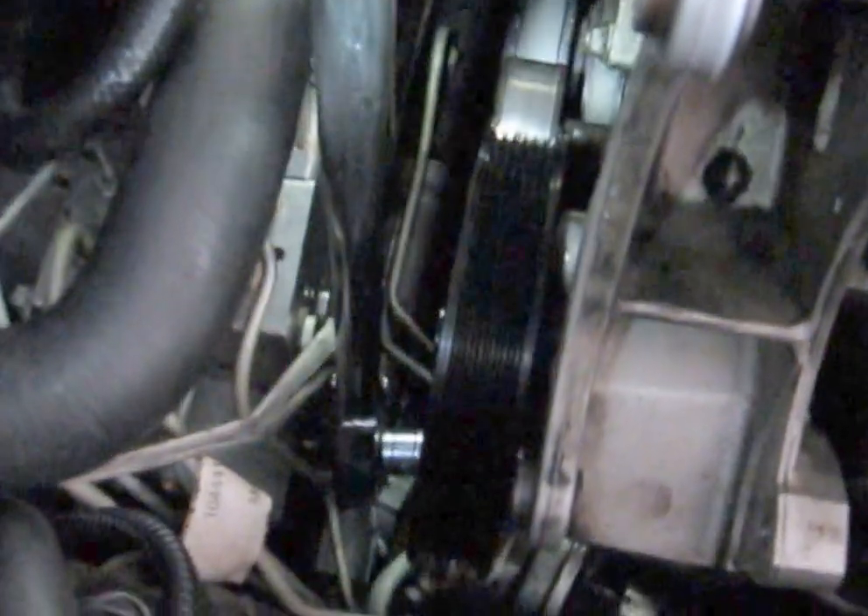Here's a picture of the torque wrench — it's a 3/8 drive. I've got a little one-inch extension into a short 13mm socket, and I'm on the third one down — I think it's the one that goes right into the pump. I just want to show you how I'm getting the torque wrench in there. You can shove on that ABS block to get another half inch or so. I've got all four of them torqued to 25.